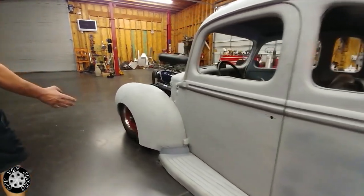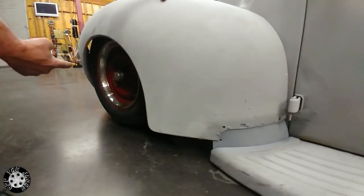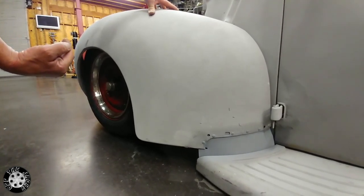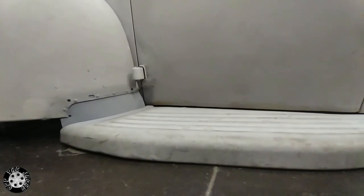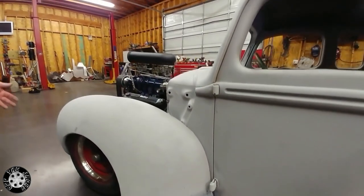We had to play with the front fenders again. I had to raise the fenders up a little bit, because as low as this thing sits, it does have a drop axle in it — they call it a suicide drop axle, where the steering rod is in the front — because the way this oil pan is in this motor, it drops in the back, since Ford motors have the oil pump in the back. We had to move the steering rod in the front to clear everything.